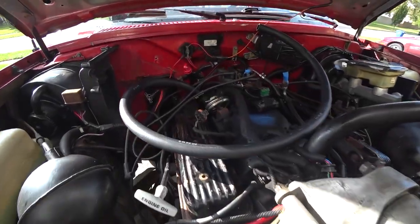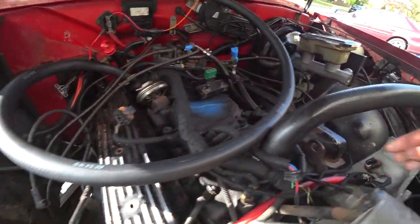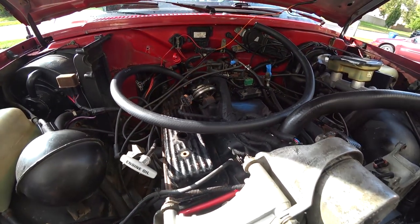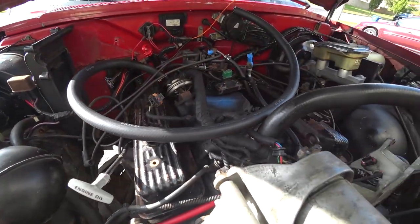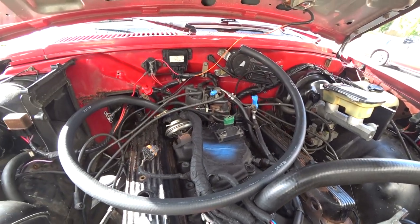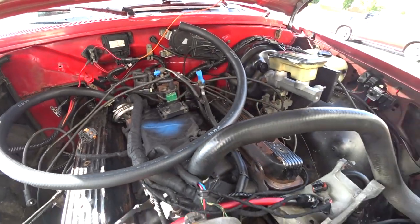The reason why I'm changing that is so I can go up a little bit higher and over, because you might notice the valve covers are not attached. I've got new valve covers and the new throttle body. I went through, cleaned the EGR valve, and installed new intake gaskets.